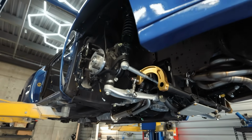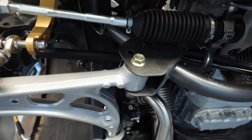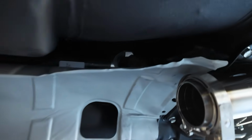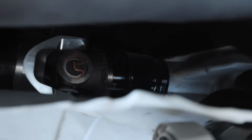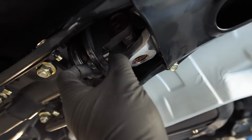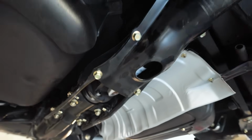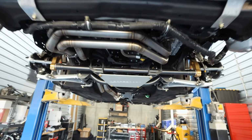This is looking pretty good. So we got both of our front axles in, those DSS 750s. Coming back here, we have our carbon fiber drive shaft installed as well. There is a small amount of slop up there, but it does fit. Worst case scenario, if I find it to be an issue, we can have a spacer plate machined to eat up that negative space and just put it in between here and use a couple longer nuts and bolts on there. But dude, we almost have a full freaking drivetrain in this car at this point.